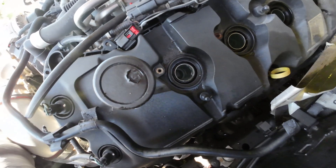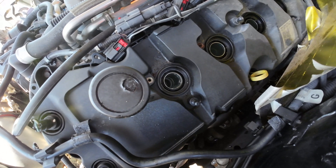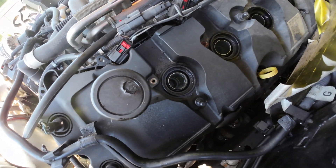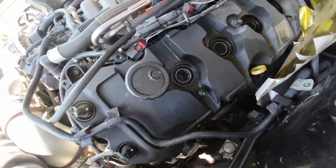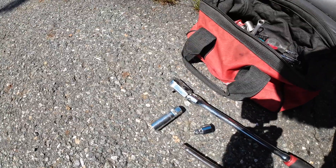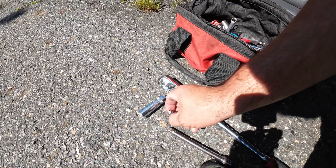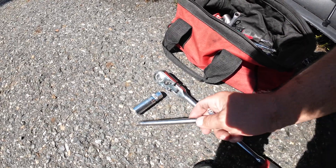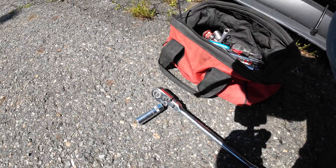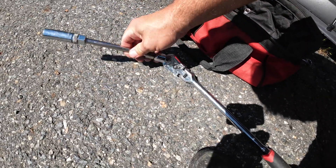On a Coyote you're going to need a few extensions to get down in there deep, and you'll also need a 5/8 socket. A lot of companies make special spark plug sockets with a little rubber ring inside that holds onto the plug so it pulls it out. I also recommend using a half-inch ratchet so you can use more torque. With most modern cars you're going to have an aluminum head, so make sure you don't strip out those threads. Use anti-seize — I'm using a half-inch to 3/8 adapter which should be fine.